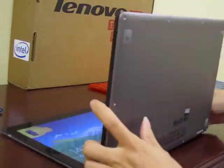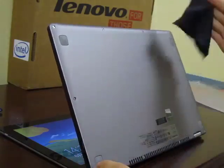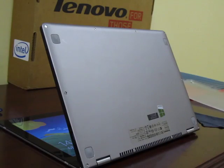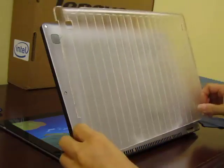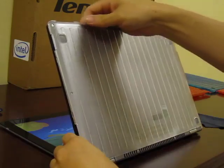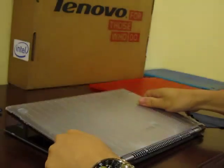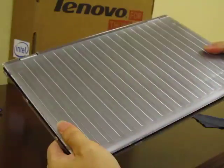Next, turn your laptop upside down. Again, wipe off your laptop with a soft cloth to remove any dirt or debris. For the bottom cover, you will need to align the tabs in the back near the hinge, and again, push down until you hear the clicks. You have ten tabs on the bottom cover: two on the back, three on the left, three on the right, and two on the front.